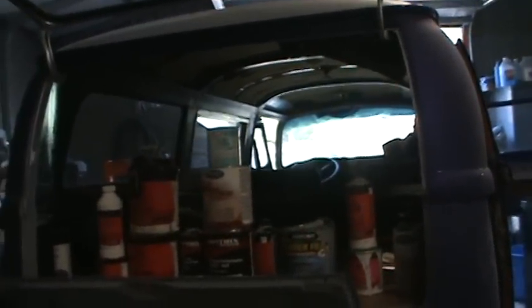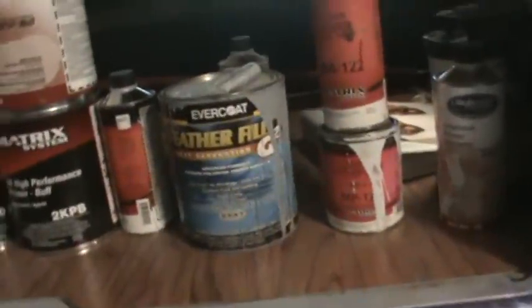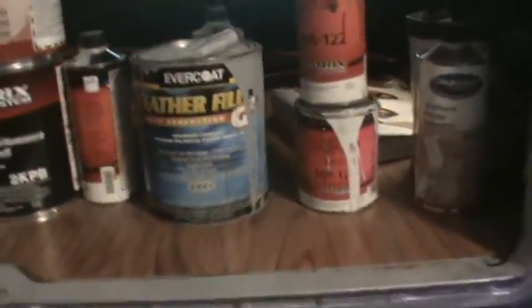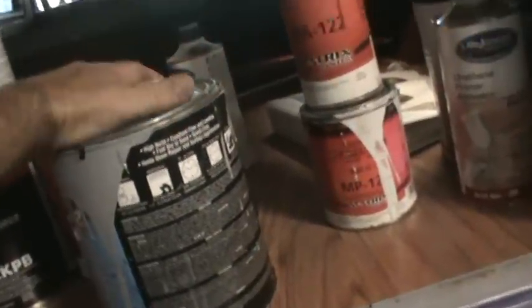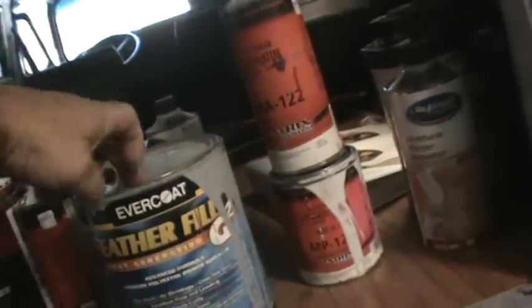The next guy that had a question for me was Chris from the UK, and he was asking about Bondo. The Z-Grip's fine, Chris. It's in the Metalworks family. I don't have any 3M or Evercoat products here right now other than the G2, and I will make this mention about the G2. It has been said that this can go over bare metal, but when I watched the video that Evercoat puts out, they recommend an etch primer before you put this down.